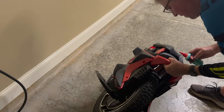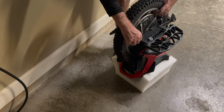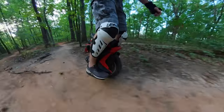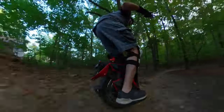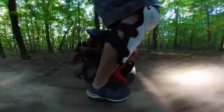So I went back and I put some PTFE oil on there. Gets really messy, but it did help. Just like the sliders before, it would only work for the first few miles and then it would go back to the sounds that it was making. Also, since that video, I did some more strenuous testing of some trails. I did some jumping. I did some moderately fast trail riding. And soon after that, the performance of the suspension sliders started degrading quickly. So much so that it is my belief that there may actually be something broken on the inside.